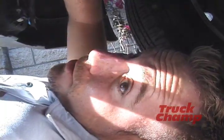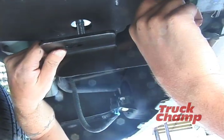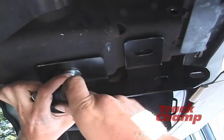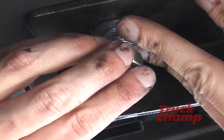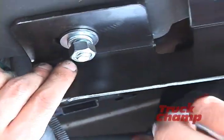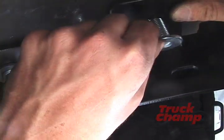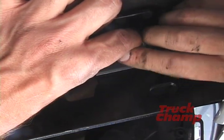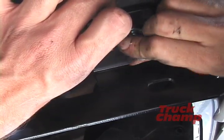Now we're going to move on to the driver side. Facing forward to the front of the vehicle, shimmy it in there and slip it over the bolt. The nose of this bracket has to point outward. Put an M12 flat washer on the bolt, then a locking washer and an M12 nut. Don't tighten it too hard because we're going to have to adjust it. Then take another M12 bolt down through the hole, slip on the M12 flat washer, locking washer, and M12 nut — hand tightened.